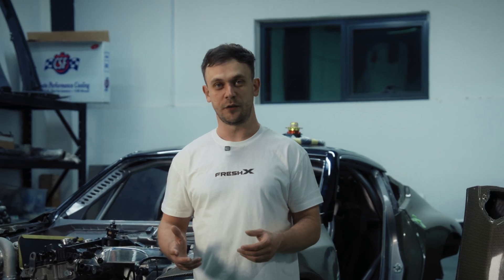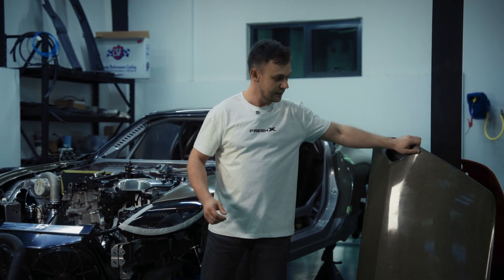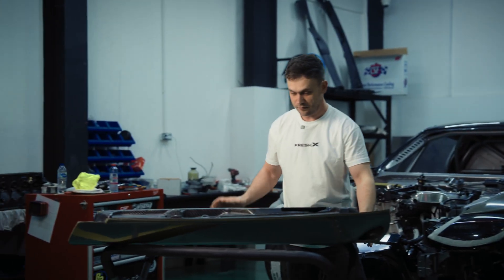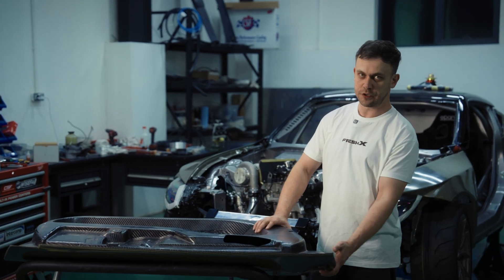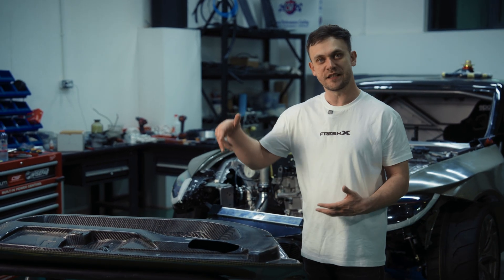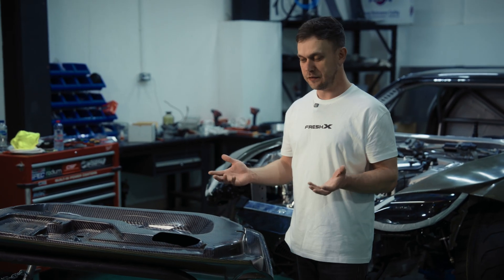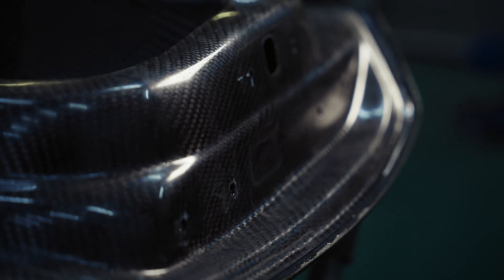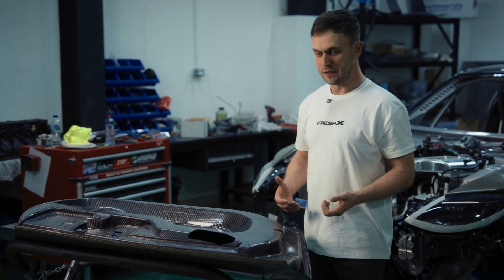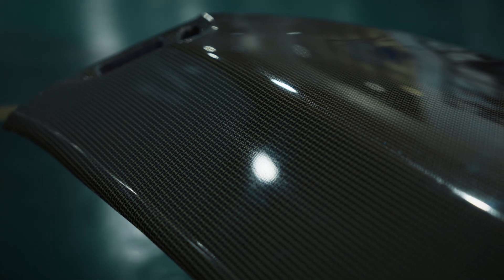Back to our current body kit — during development we discovered a few areas for improvement and can now be 110% sure it's ready for mass production. For example, our door has inner and outer shells, and when we bonded them together we found there was no access to the inside of the door — sometimes you need to repair the lock or door handle inside. We need to create a different model to allow that access. We also found that the gap between the inner shell and the chassis is too large, allowing smoke to enter the cabin during runs. We will create a new model and change the full design of the inner shell.